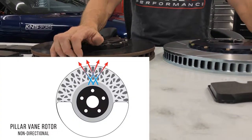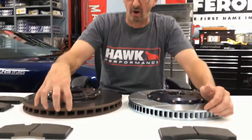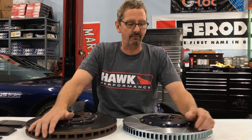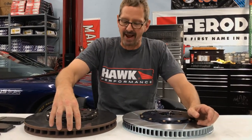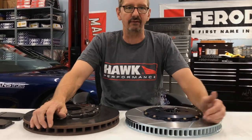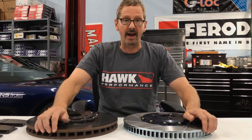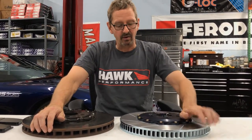I'll move these pads. If you look at the vane design of the two rotors, GM and Brembo use a typical pillar vane design — it has a very thick cheek and a series of pillars in there. It works perfectly well, allowing you to make one rotor ring for each side of the car. I did have a couple of conversations with fellows from Michigan and they mentioned GM going through a few iterations of this rotor ring to get enough mass and area to help the car brake under track use. We certainly feel like the ZL1 brakes are pretty adequate for the car.